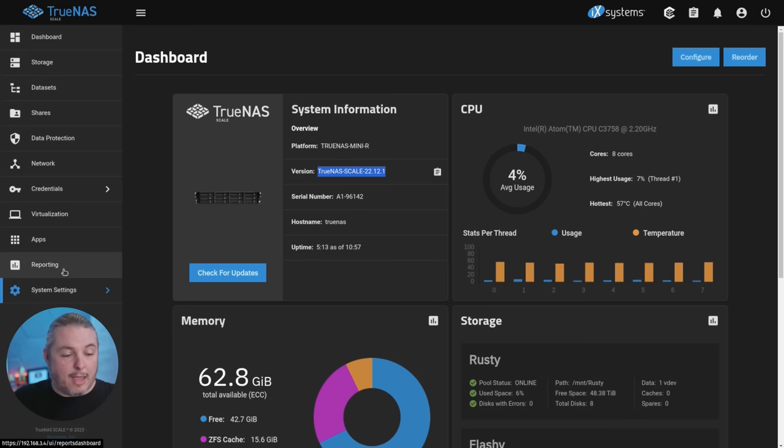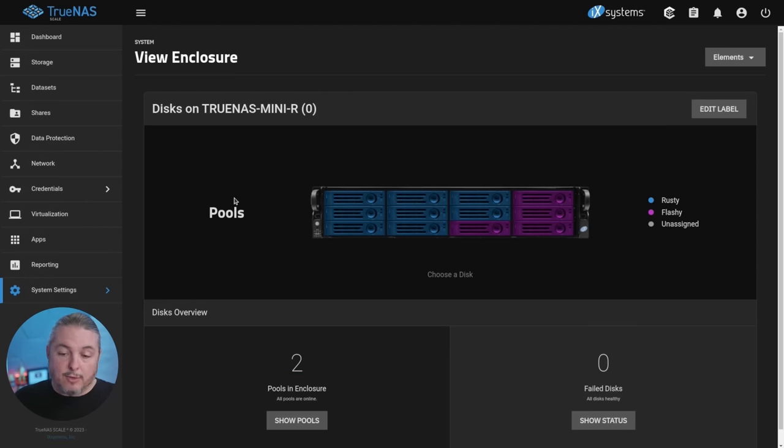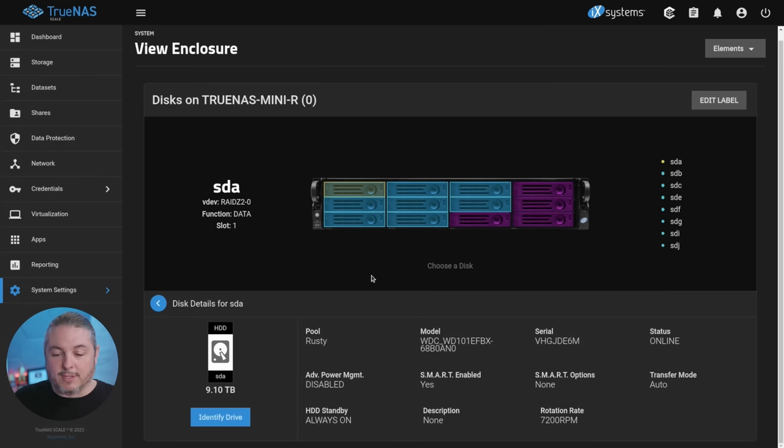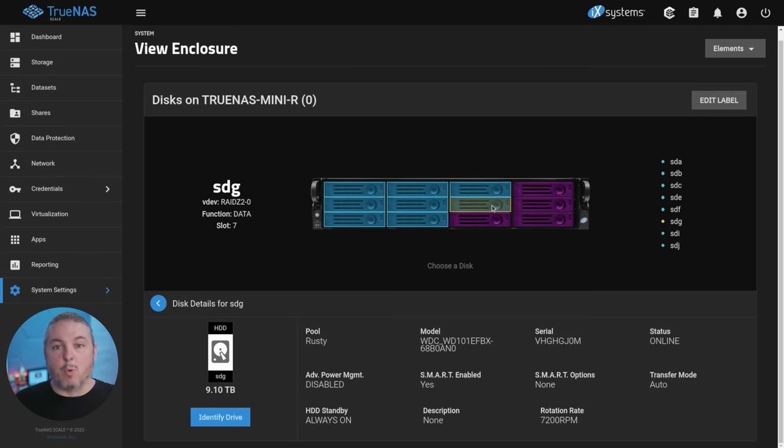Let's take a look at the enclosure, because this is one of the advantages you get when you buy an iXsystems Mini versus doing a DIY build — there's no way to replicate this exact enclosure management in a DIY build. When iXsystems and Supermicro work directly together, they can put these extras in there, and it's really convenient being able to slide these drives out and know where any of them are. We have it showing two pools: the 'rusty pool' has some WD Reds — spinning-rust 7200 RPM drives — and the 'flashy pool' has some 1.75 TB SSDs. For a video editing use case, you might edit live footage on the flash pool and migrate completed projects over to the spinning pool, or replicate between them.